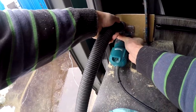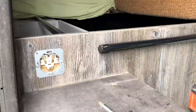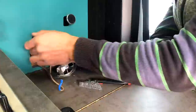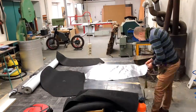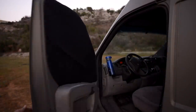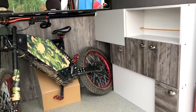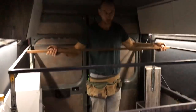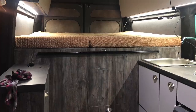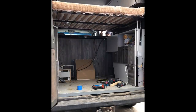After you install all the cabinetry, it's time to plug things together — wire the LEDs, switches, water pump, battery, fuses, reversing camera, fridge, and so on. This is a very satisfying phase because you see the final product coming together. In our case we finished the bed at this point since we no longer needed easy access to the back — that means welding the frame, installing lifting support, and making it ready for linear actuators that will lift the bed up.